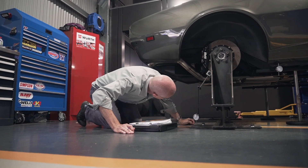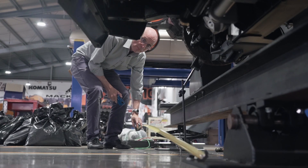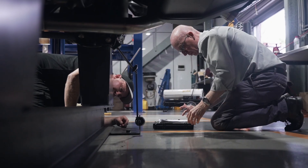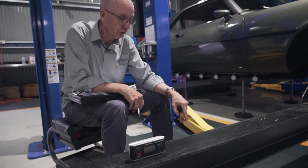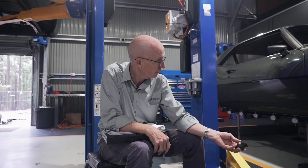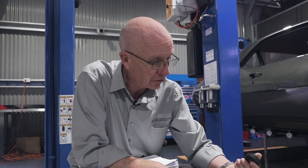What we're doing here is measuring a baseline before we apply any force to the vehicle. I'm going to read off all these dial gauges, note them, apply the load, re-read them, and measure how much twist we're getting — then compare that to what we got with the unmodified vehicle. We're about to apply the torque to the chassis by applying a known load. This jack is sitting on a scale and we know how far it is from the pivot centre, so we'll be able to work out the torque. We're going to load it to the same load as the unmodified car: 760 pounds at 2 metres — please forgive the mixture of units, we have been consistent.